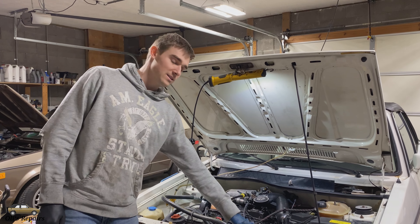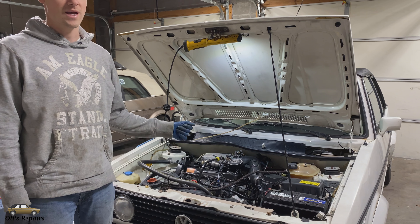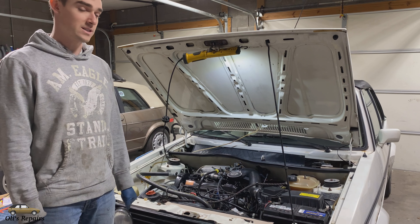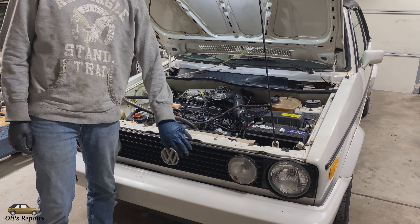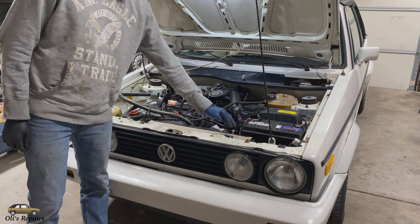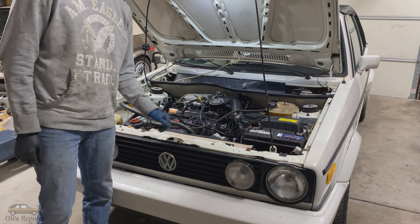Reinstall the brackets. Normally I like to paint these black, but this paper one is really just temporary until I can get my hands on a corrugated plastic piece — then I'll paint the plastic one black. Now your car is going to be running cooler, because all of the air that the fan is either sucking in, or that comes in while driving at high speeds, will go in through the grill and through the radiator and exit here, and no hot air will be getting sucked back in through your radiator.